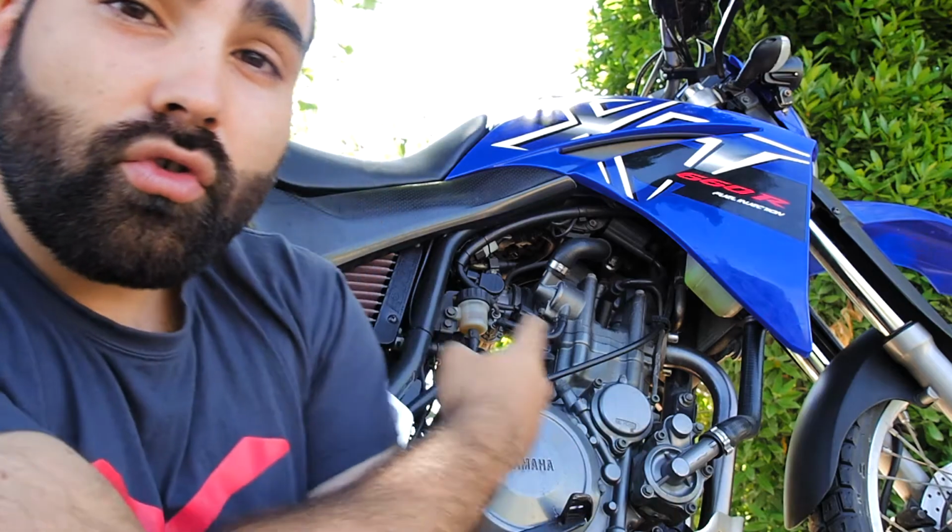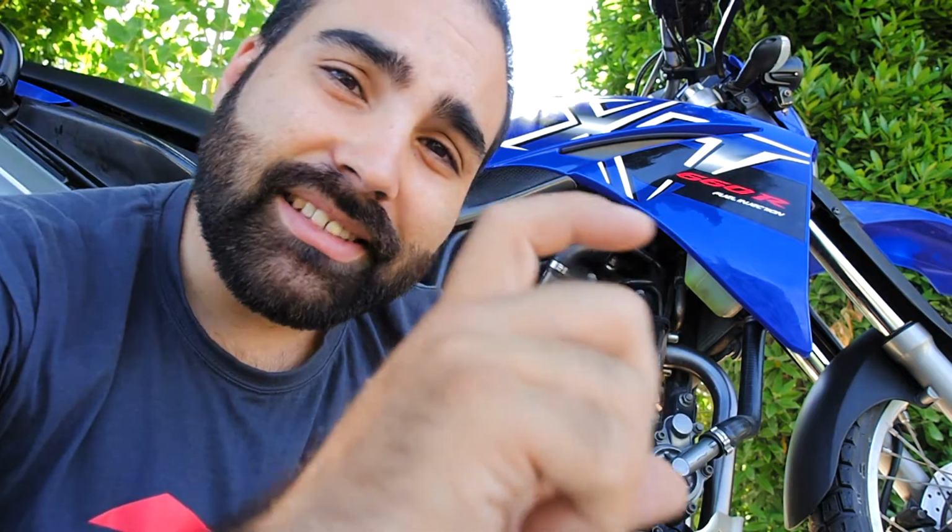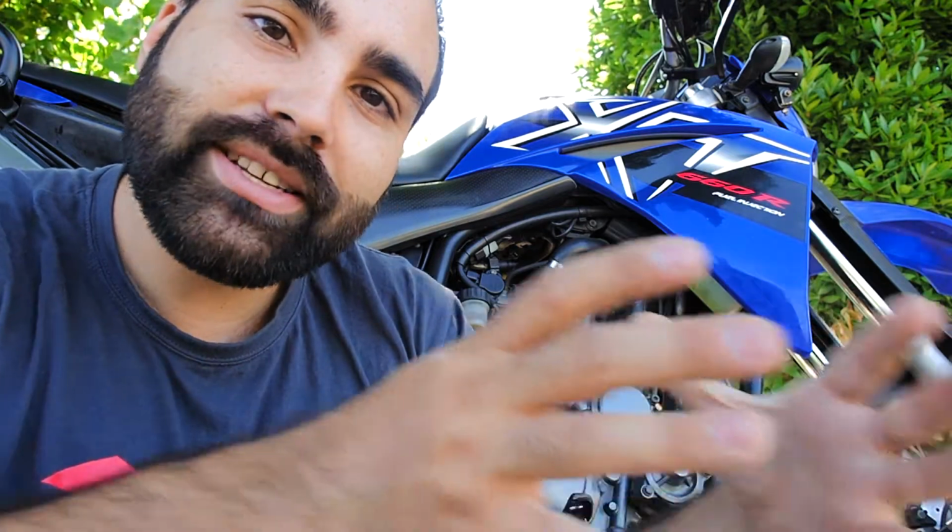And the brake oil right here, well, that has a little level. It says high level and low level. One very common mistake that people make is when it starts going down, they put more oil. That's no good. The brake system is a closed system, meaning that the oil is not spent. It just moves from one side to the other.